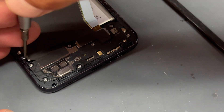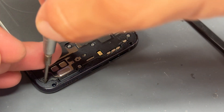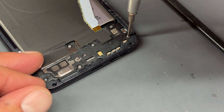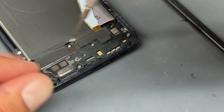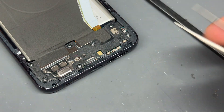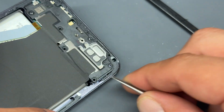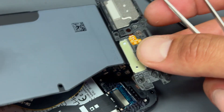This is going to be a really quick repair, by the way — you can tell with the speed of my voice. We're going to go ahead and remove seven crosshead screws from this bottom area. There's tweezers to get that last one. Then usually what you find is on these there'll be a small arrow pointing to a pry point, and I use the tweezers to lift it up and separate that loudspeaker and plastic cover away from the phone.